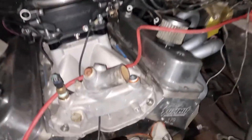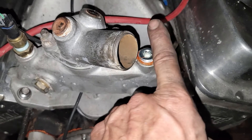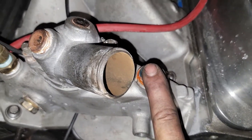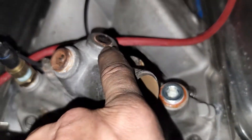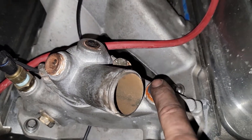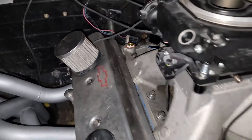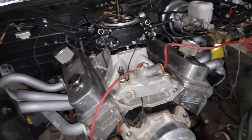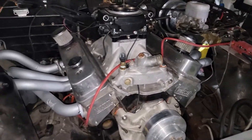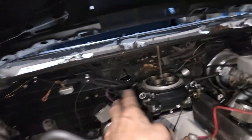I went ahead and plugged the water pump outlet for the heater hose and the intake. I took the other coolant sensor out and plugged that — that was the factory cooling sensor. I also plugged the other heater hose so it basically looped from here to there; I took that out and plugged it so it doesn't have a big hose. The dipstick's back on, and the Holley is all plugged back in except for the wideband.